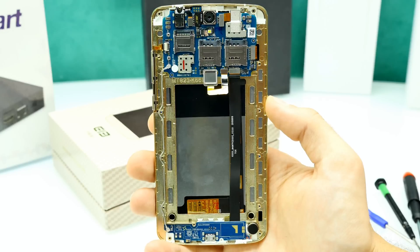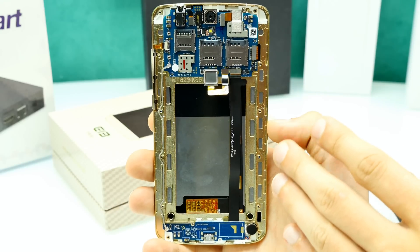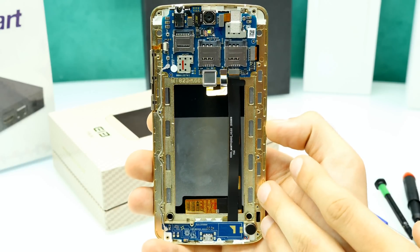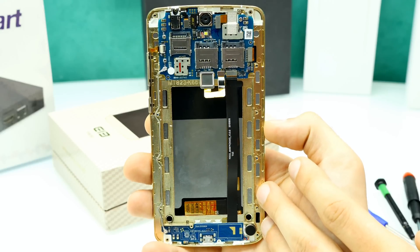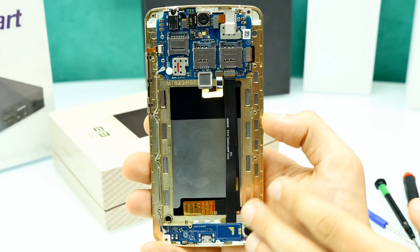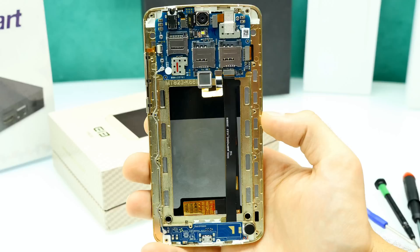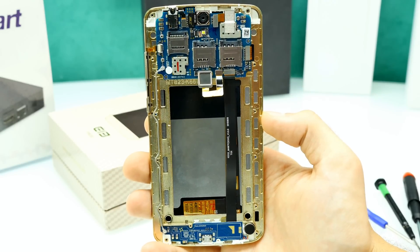Here's a quick look at the frame of the P8000 with everything still attached. It's not only an outer metal frame around the phone — it's a whole metal chassis. It makes the phone heavier, around 20 grams heavier than the P7000, but the stability is so much better, and the whole build quality is really, really good. It's also painted golden here. I'll now remove the bottom PCB and the top mainboard so we can check everything out.